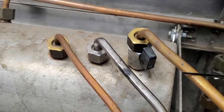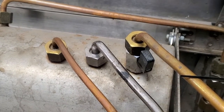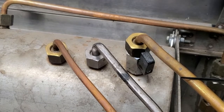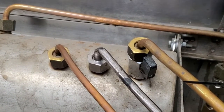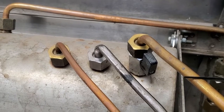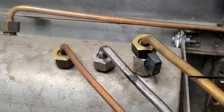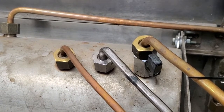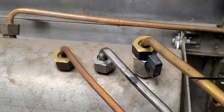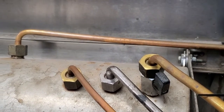On most machines you have to shut the machine down to service the steam valves. Individual shutoff valves are becoming more common on advanced machines, with manufacturers putting a shutoff valve in-line or right at the boiler. Typically you're not going to see that on an entry-level machine, as they're trying to save cost as much as they can.